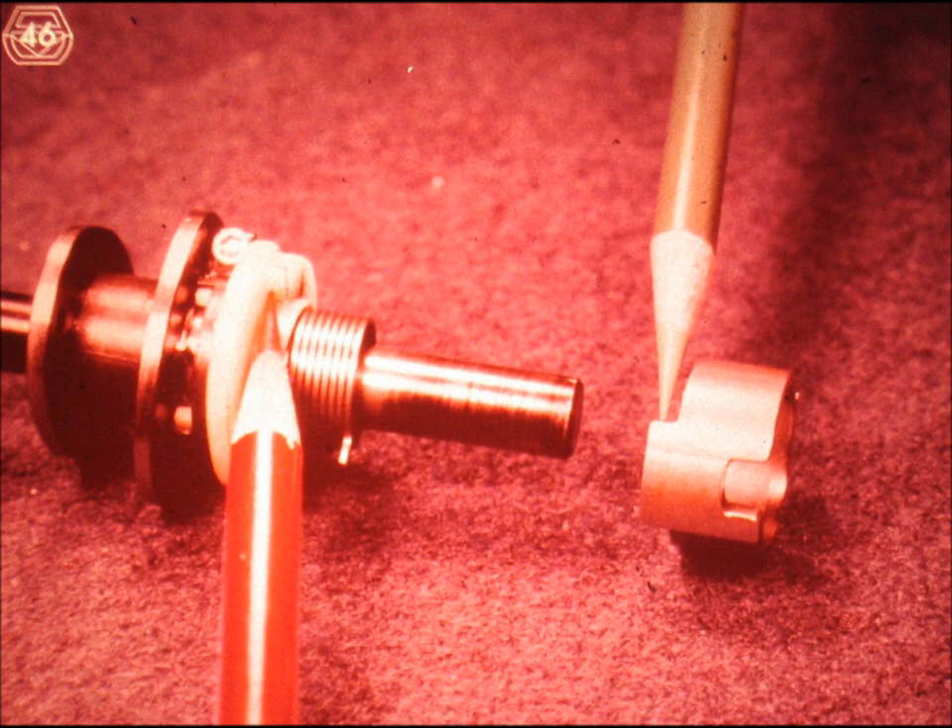In the case of the ratchet clutches, the overthrow stop is simply the outside corner of the opening in the clutch disc. But the overthrow stop for the printing mechanism is adjustable. After the overthrow stop has interrupted the top-to-front rotation of the shaft or cam, the clutch spring starts acting on the shaft or cam, trying to turn it back top to the rear so as to allow the spring to collapse again. The spring tension is then literally trapped in the clutch, with the latch holding it on one side and the check pawl on the other. The motor runs idle until the operator releases the latch again; the spring then collapses, closing or engaging the clutch, and the whole thing starts all over again.